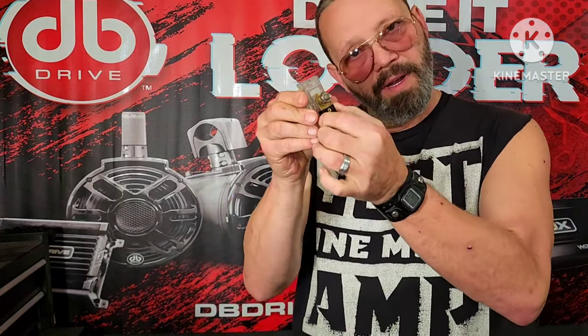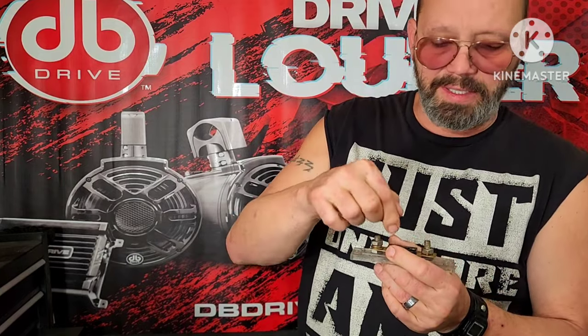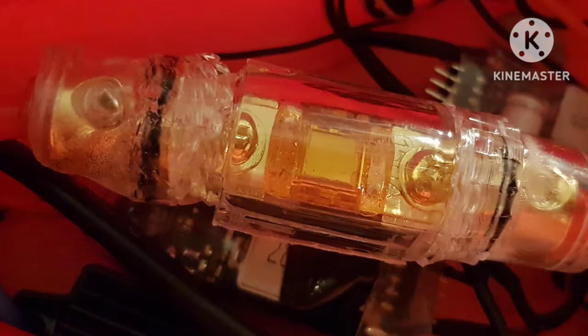Now, if your nut loosens up, you end up with a loose connection. It'll still connect, but it'll only connect in tiny points and it'll get hot. When it gets hot, it'll get more resistance and pull away, melt and deform and get looser and more resistance. Before you know it, you've got one of those melted fuse holders that you see and you go, "Why didn't the fuse blow? It's all melted, the fuse failed." No, you failed. The fuse was just an innocent bystander.